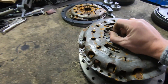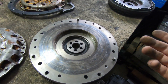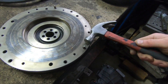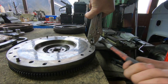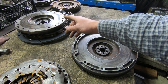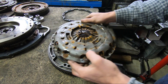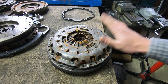Carrying on with the flywheel — we're using a complete BMW clutch, so you have to modify the Ford flywheel to accept the BMW pressure plate. That means drilling the holes for the mounting bolts and positioning pins. I highly recommend this operation be done by a machine shop to ensure everything is centered. Once the holes are sorted, remove the original positioning pins — the easiest way is to hammer them a little and then use a set of grips and hammer away. Once removed, install the new bigger positioning pins and mount the clutch plate spacer onto the flywheel. The BMW clutch fits perfectly.